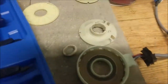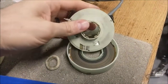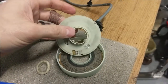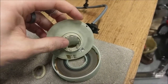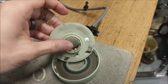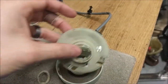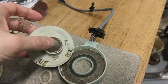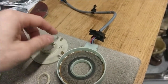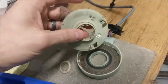What happened to me on this one: I went to a car wash when the inside of my interior was about two degrees Fahrenheit and the engine wasn't even warmed up yet — I just wanted to get my windows cleaned off. All the hot humid air came into the vehicle and condensed all over everything, practically water droplets dripping down the windows. Everywhere there is an unsealed module with electronics, that moisture is going to get in. The two-degree surfaces had the hot humid air condense on them, and when I came out of the grocery store at the other end of the parking lot, that's when my electric power steering stopped working.